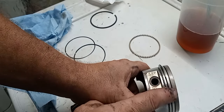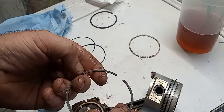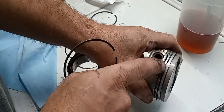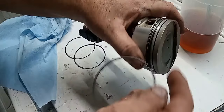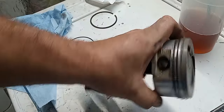I'm going to get our upper compression ring. These are actually marked — it says 'top' — so the marked side goes up. What I also do is stagger the second compression ring 180 degrees from the top oil ring, and then stagger the upper compression ring 180 degrees from the second compression ring. Just lightly spiral it on like that. Pretty simple.